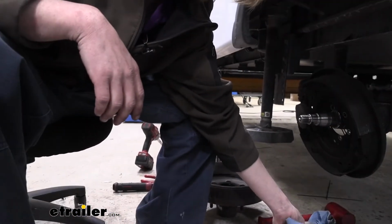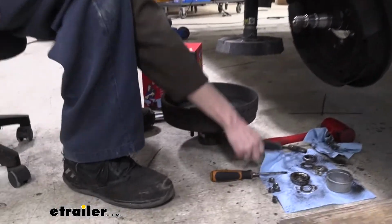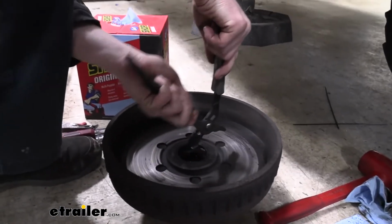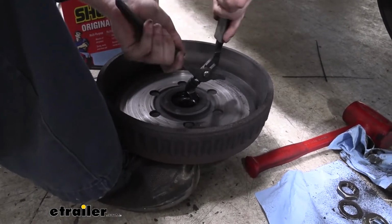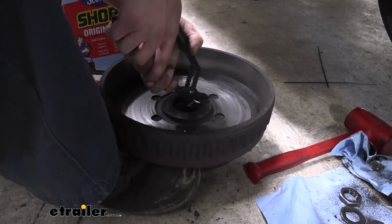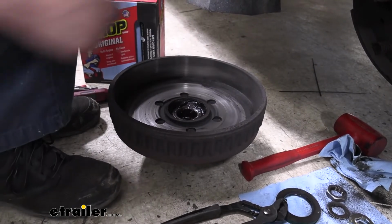Now, as far as our other ones go for the inner, to see those, you would have to remove the seal here. And the seal just pops out of the back here. We're not gonna be reusing our drum or anything, so we can just grab in here with our channel locks and get under it, pop it up. We're not trying to save the seal or anything like that either. So that's fine. And then once you pop that out of there, you can then access the bearing that's inside.